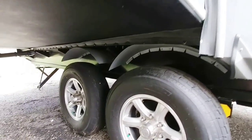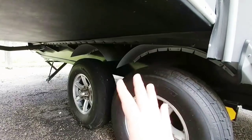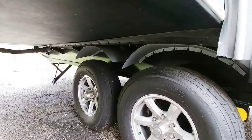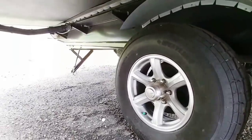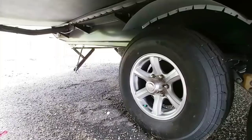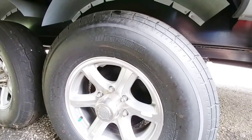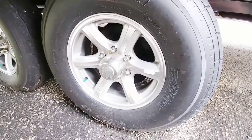It rides on a 12-inch I-beam frame with a 2-inch boxed section welded underneath — a very durable and rigid frame for a travel trailer. These are features you really don't see with most travel trailers. It does have the upgraded Lippert Equiflex suspension, and it has strong arms which help add stability to your trailer when set up — basically extension rods you tighten down and then tap the stabilizer jacks to keep the unit stable inside. One thing I would like to see upgraded are the Westlake tires — these are 10-ply E-rated, and I'd really like to see an F or even G-rated tire on a coach this long and heavy.